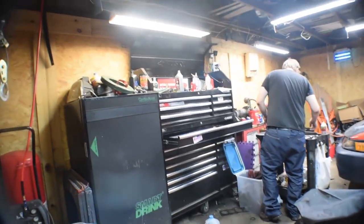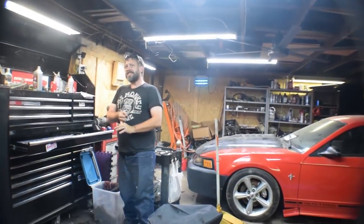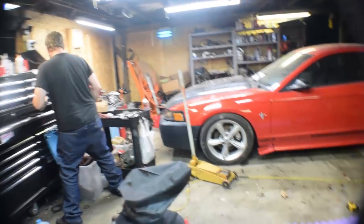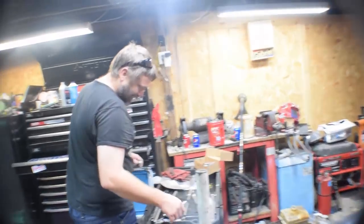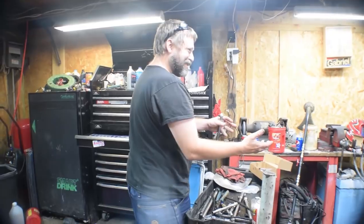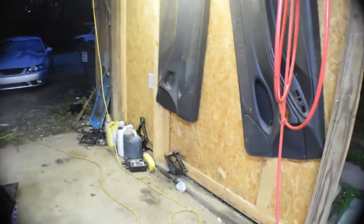I've never seen a car with so many sensors. It has a mass air sensor and a barometric pressure sensor. They do the same thing. There's gonna be that one person that says, no, they don't. You're right. One measures the amount of air being ingested. The other measures the density of the air. Now, unfortunately, all the other car companies can use a simple equation to go from amount of air ingested to density. If only it was that easy.